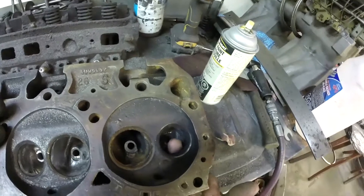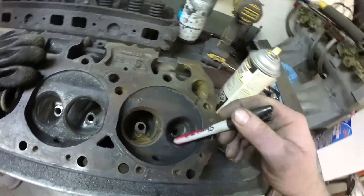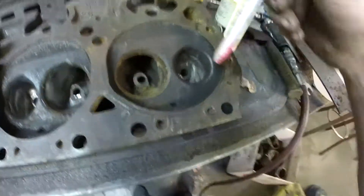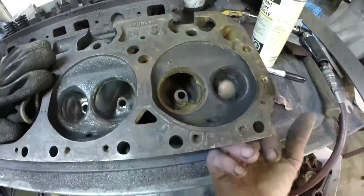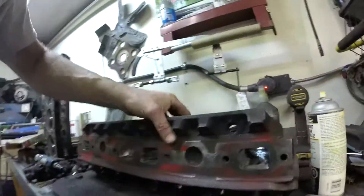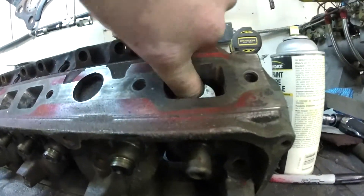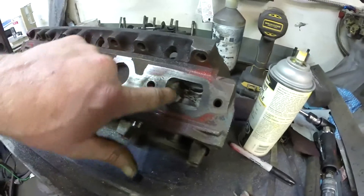When you look in here, you've got all this extra area right here, and that extra area shrouds the valve. If you've ever heard of somebody saying they're going to unshroud the valves, they're opening up this area underneath the valve seat. Same thing on the intake side — this is super thick here and it doesn't have to be. When the exhaust is coming out you want a nice, simple, smooth passageway. If we look at it, it goes in and then it hits a lump, takes a sharp turn, then a nearly 90-degree turn. Over here it was tight and sharp — bad for flow. It necked in.